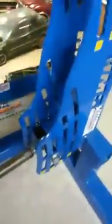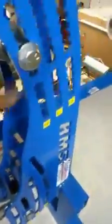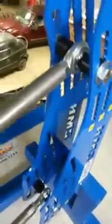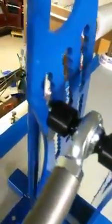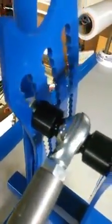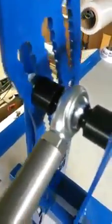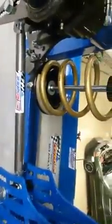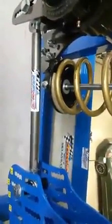If you order the plates as a kit, I'll send you the bolts and these nice bushings here. That way you can — look at the travel you can get here — you can swing the heim right up over the bushing to get a lot of clearance and no heim joint bind. The bars here, we make those in house too. They're just a DOM trailing arm that we machine to size and then tap them. Put a wrench flat on them up here on the right hand thread.